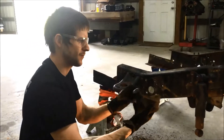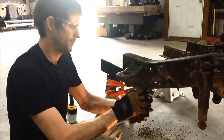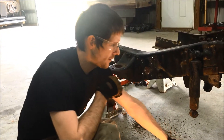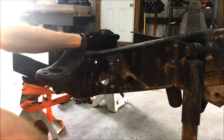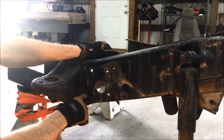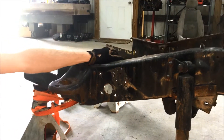Just like that, we've got the old bushing mount off — didn't take too long. Next we're going to drill out the holes for the mounts. These need to be drilled up to a 15/32nd, 7/16 clearance hole.